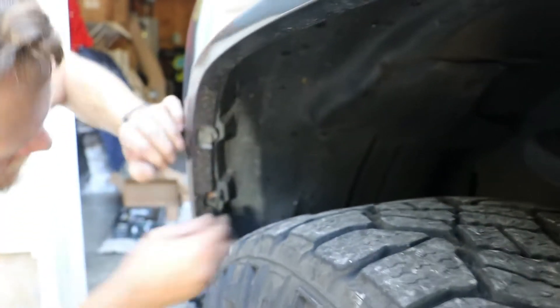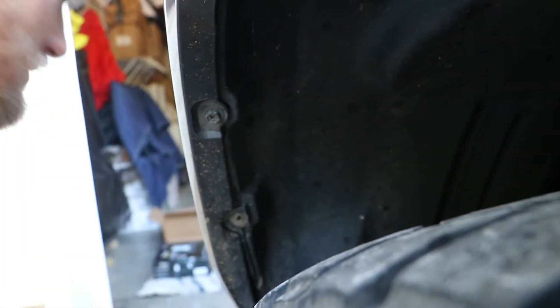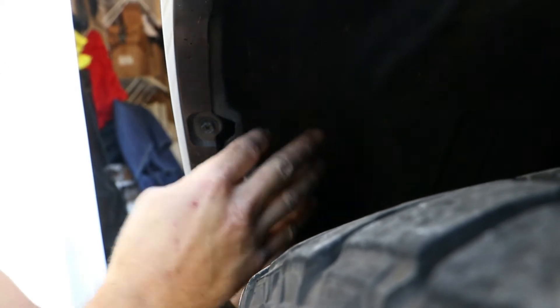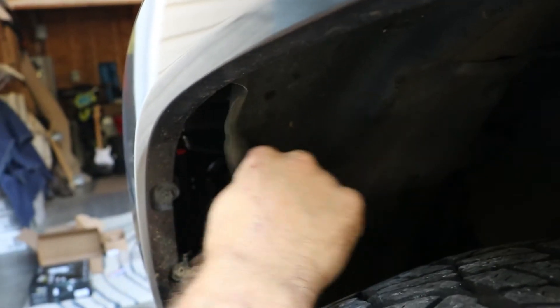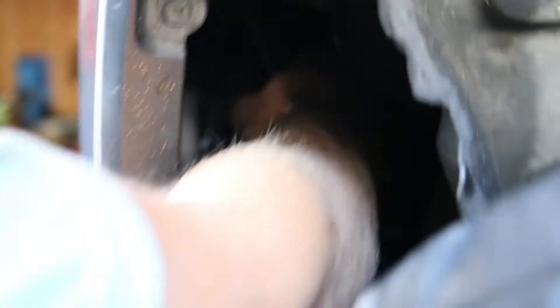you can turn it just like this and it should pop out and give you wiggle room with the fender. You pull it out and he's pulling back the fender. There's a little technique you can do: you can tuck the fender behind the wheel so you don't have to keep holding it with one hand. Just tuck it behind the wheel, and then it's held in by one screw.